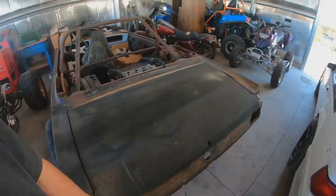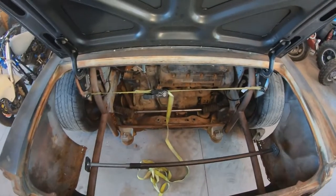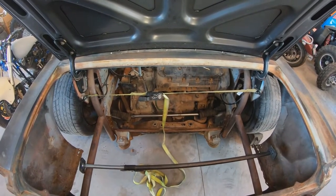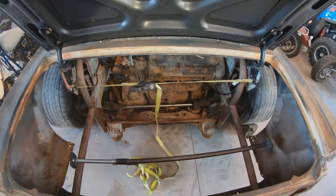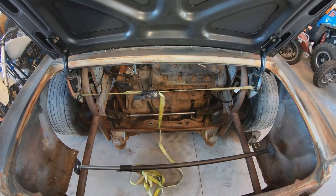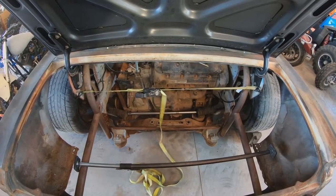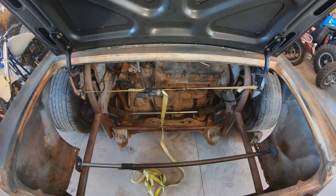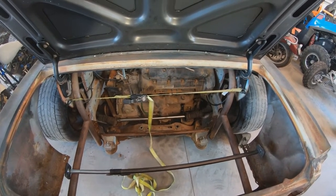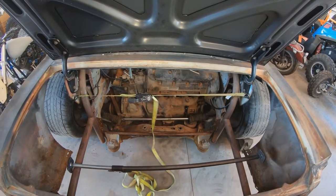The rear steering, which was the front steering in the Lincoln, I took the steering rack from around the bar there. I'm going to make bushings that will weld to that bar, and it'll bolt in place on the subframe in the same spot. So I'll set it up, get it aligned, and then I'll do the alignment myself. Once I get the alignment done, I'll lock it in position so it'll be set at ride height. So the wheels will toe in a little bit when it goes down, when it's laid out all the way, but it's pretty low to the ground now.